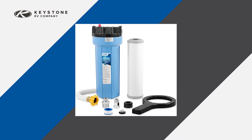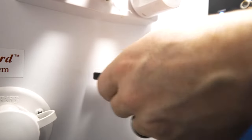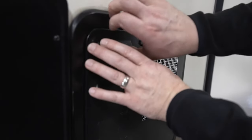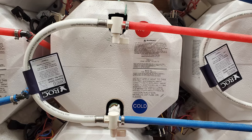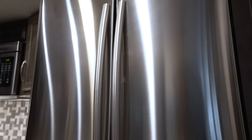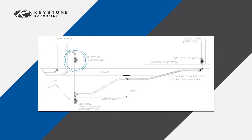If equipped, use the bypass tube for cartridge filters. Depending on the model of RV you own, you may have to remove an access panel to reach the bypass valves, or it may be located in a convenience center like this one. Turn the water heater bypass valve or valves to the bypass position. If you don't have a convenience center, the easiest way to locate the bypass valves is to locate the water heater on the outside of the RV — the bypass valves will be on the back side of the water heater, on the inside of the unit or in the basement storage compartment. If your RV has a residential refrigerator, the ice maker water line should not be winterized with antifreeze. Simply drain the line along with the rest of the water lines, then close the ice maker shutoff valve located under the island.